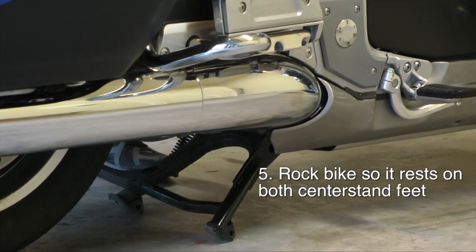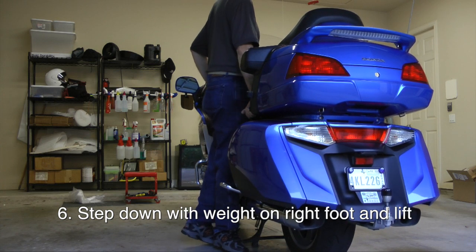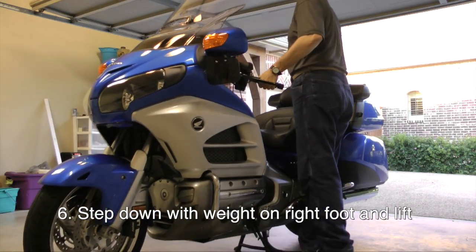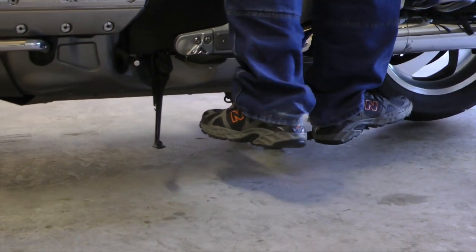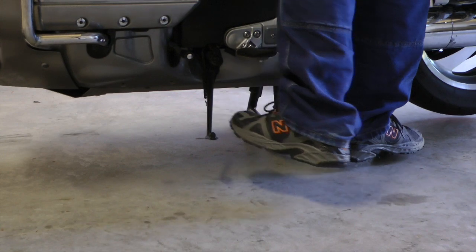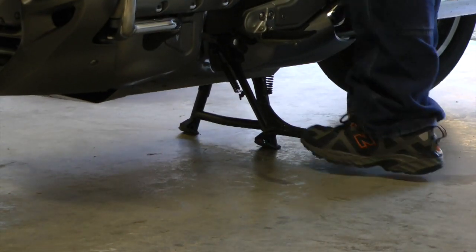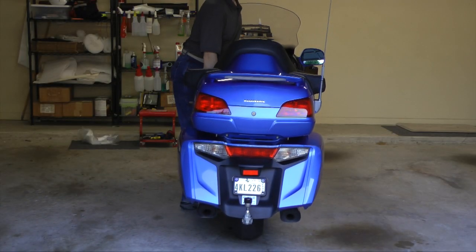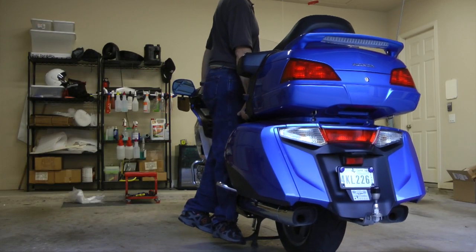All that's left to do is basically stand up, put all your weight on that right foot, keep your right arm locked, and pull up as you step down — and that's it. You'll notice my left foot actually comes off the ground; that's because I'm putting all my weight on the right foot and lifting up with my right hand, and the bike will just pop right up into place. I can do this all day long. Weight on the right foot, right arm straight, left hand on the left hand grip — the bike will come straight up on the center stand.